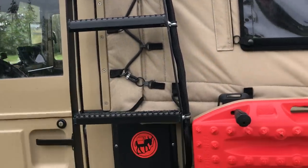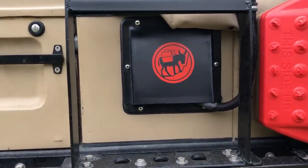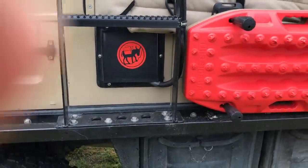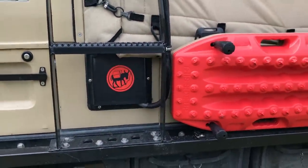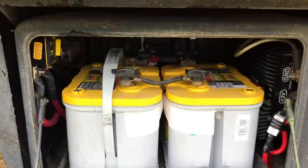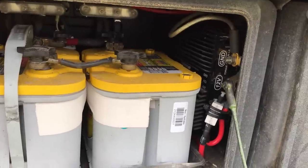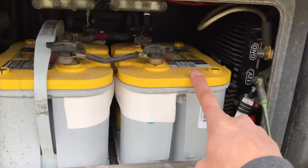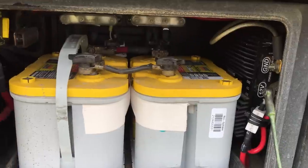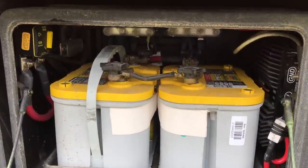You can see all the wiring run down here into what I affectionately call the heater vent — which Mule came up with to replace the normal grill cover for the auxiliary heater, since I don't run that, so we used that space to bring all the wiring in. Down here in the stock bins, one holds the dual batteries for the 24-volt system, and one of the three 12-volt subsystems. Using an equalizer I can pull 12-volt off of just one battery, though I don't like to do that much — mainly just for the fuel injection, and maybe power steering when I add that.